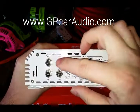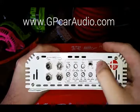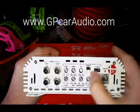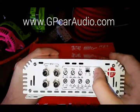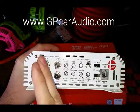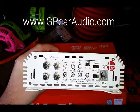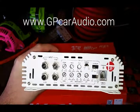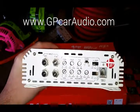As you can see, it features Tiffany-style inputs. Doing some reading up — I haven't used this yet — but this TLA high-pass filter, when you switch that over, allows you to just run RCAs through channel one and two right here, and then that's going to give the signal to channel three and four as well.